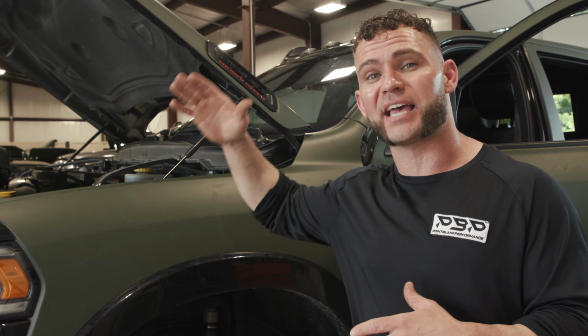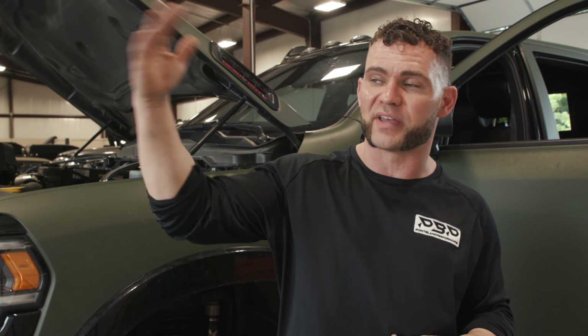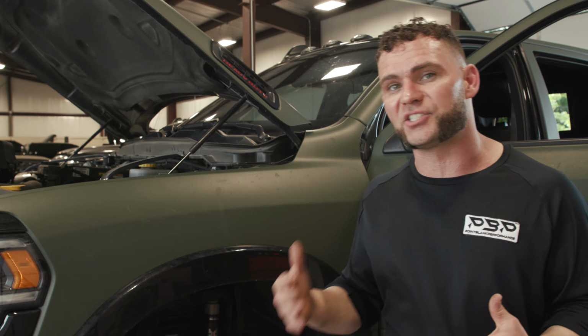What's behind the build? Well, it's got a second gen swap, an S472, the billet forced induction with an 87 turbine. That thing will make some power. For fueling, it does have a set of 100 over injectors. For high pressure fuel, we have a 12 millimeter CP3 pump. So we got high pressure fuel, we got the air, we got the injectors, we've got the recipe, but there's one thing standing in our way.